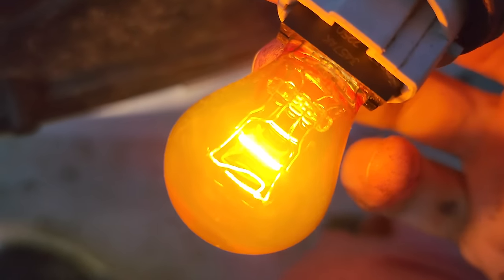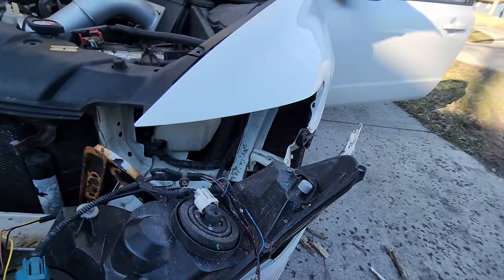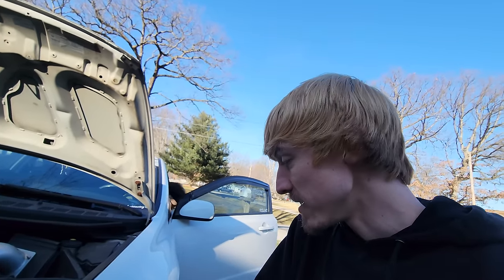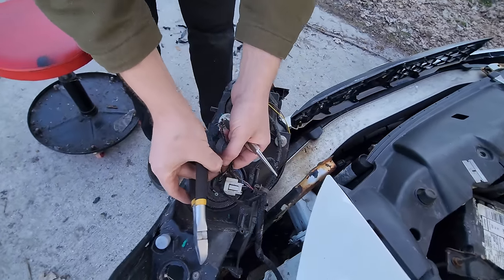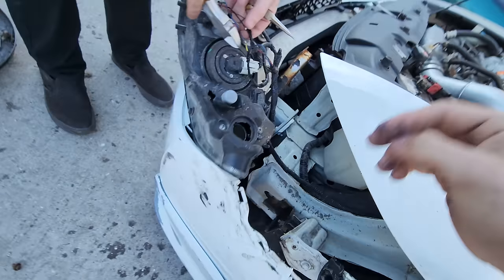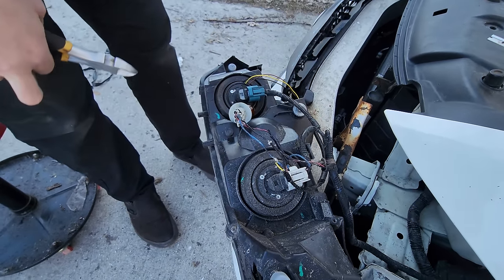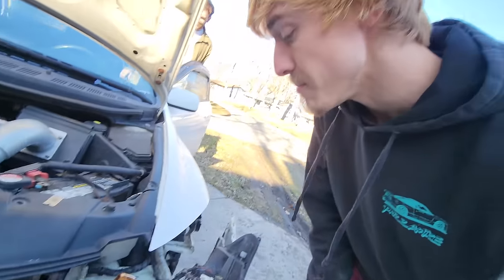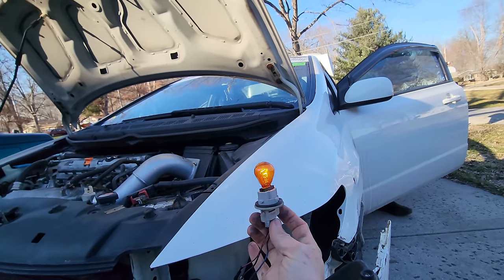After switching the bulb direction, you can see both filaments lighting up. Even with the bulb removed the problem is still persistent - the light is still on the dash - so we have to dig deeper into the wiring. We're going back a step to look at the other turn signal and running light on the headlight housing itself, because there are wires spliced into the housing. There's a little crack in back and we're thinking maybe moisture got in it.